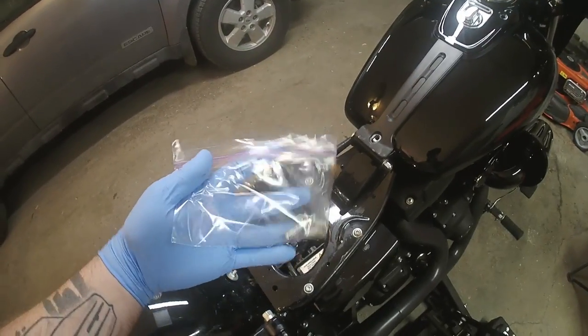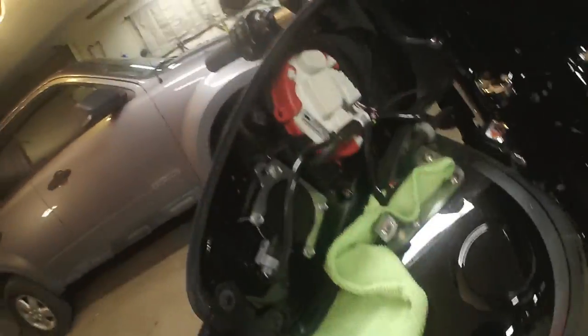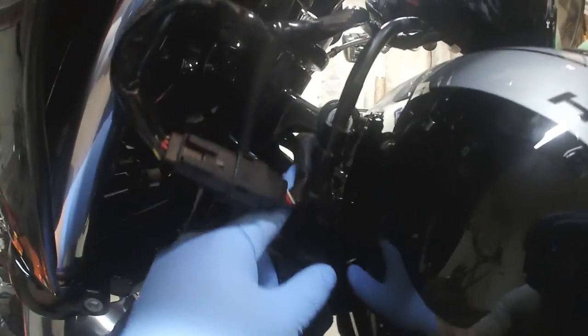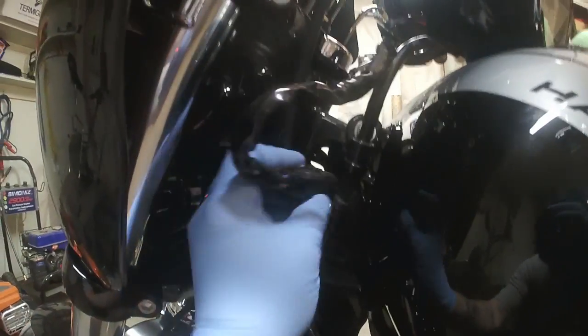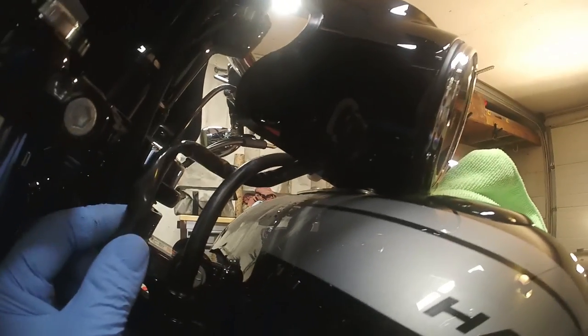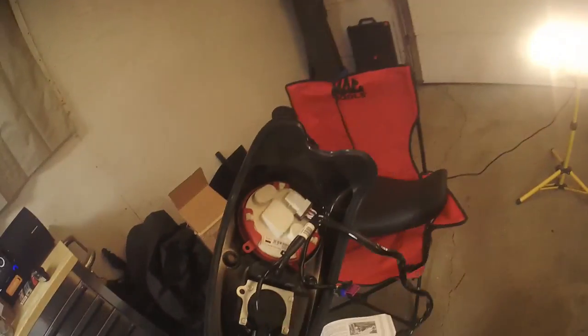I'm going to toss them in a zip lock baggie and set them in a drawer in the tool box. Take a clean rag and lay it down so you don't scratch anything, then turn this over to expose the connectors. Come over to this side of your neck, pop out that grommet and then pull on this a little bit — this connector is actually just tucked up in there. Unplug this connector and then unplug the fuel line at the module and you'll be able to remove this whole thing. Just remember that the wire goes underneath that fuel line. Unclip this connector from the fuel module and now your entire cluster can come off and you can set it somewhere safe.